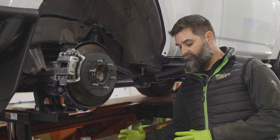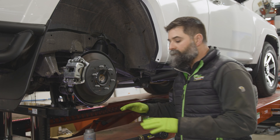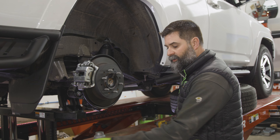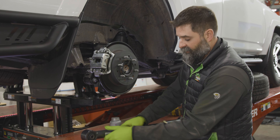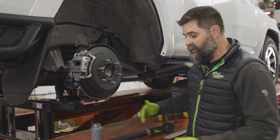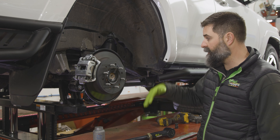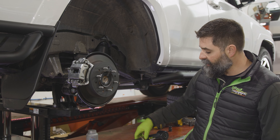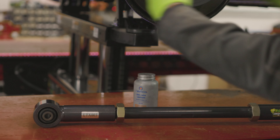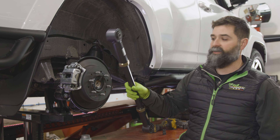So why is Ironman 4x4's link so much awesomer than everything else out there? Most heavy-duty lower links are just a two-piece design, which means only one end is adjustable and the other end is completely solid. With the turnbuckle design, you can get these mounted in the truck and if you're off a little bit or you need to fine-tune it for your alignment or to set your pinion angle, all you got to do is loosen your jam nuts, spin the center turnbuckle, and they lengthen out or tighten up. It's such a smart design and these things are heavy-duty.